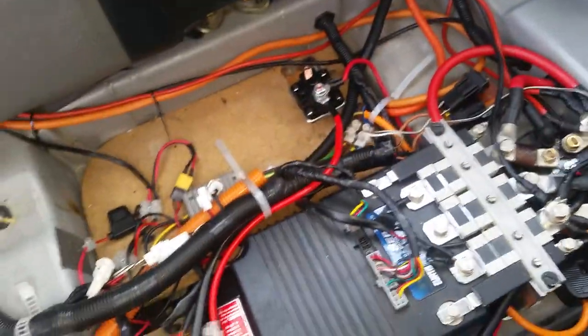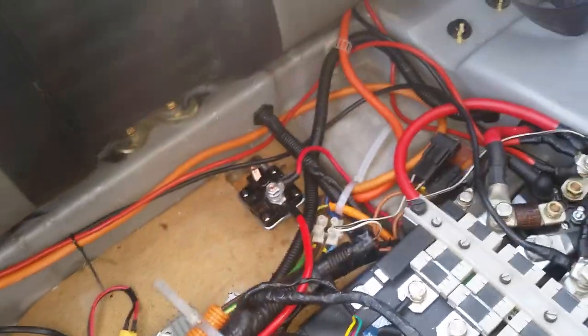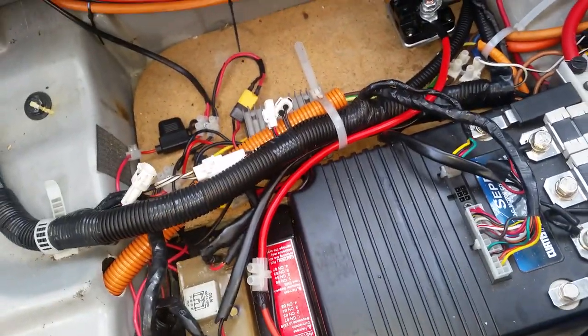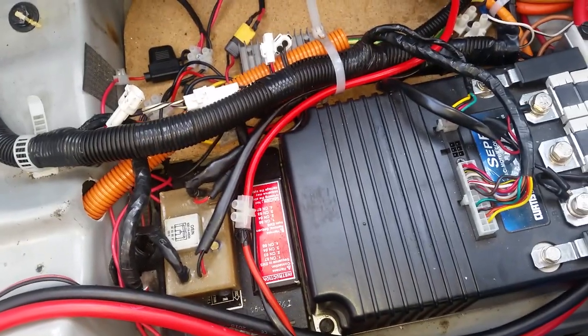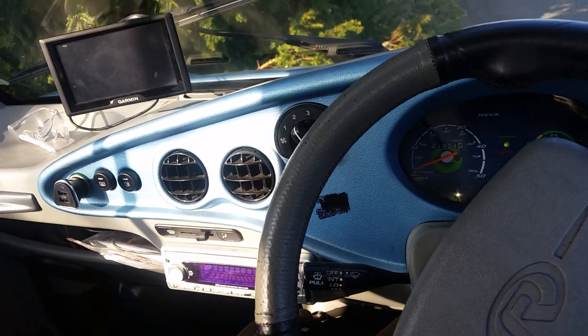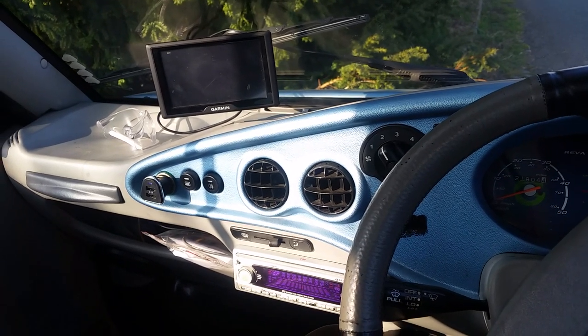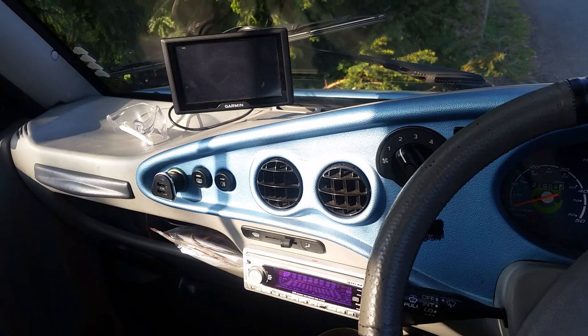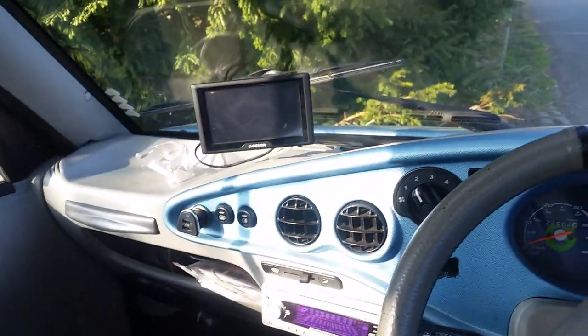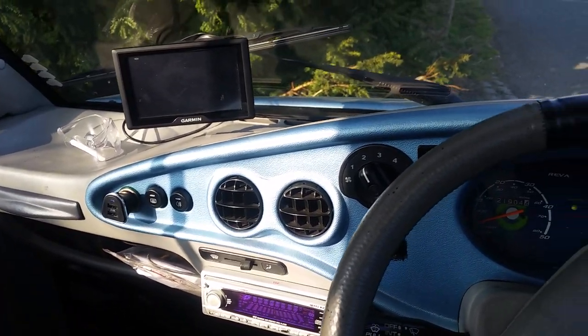That's everything done for the time being. Although it looks messy, there are no knotted wires, no coils or anything. Everything's bolted together properly, connected properly, and it's all fused as well, so there should be no burnouts and nothing's overheating. I'll also have the auxiliary power set up with solar so I can charge while on the road and when I'm standing still. I can keep the auxiliary topped up, and I'll also have an extra cable to plug into my main batteries to enable a trickle charge with solar, since I won't have enough solar to keep me fully charged.